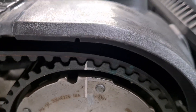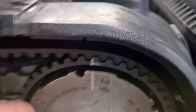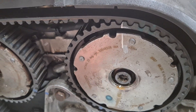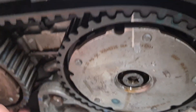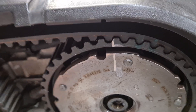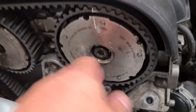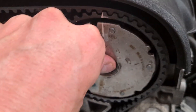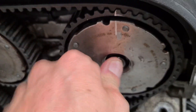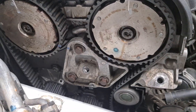They need to be in line with that notch. It doesn't look like it's in line now because these are actually floating free of the cam and I haven't tensioned the cam tensioner yet. When I tension it, that's going to pull it around. Once both are in line and the tensioner is set, you do up these bolts — they're just hand tight at the moment, so they're loose and free to spin.